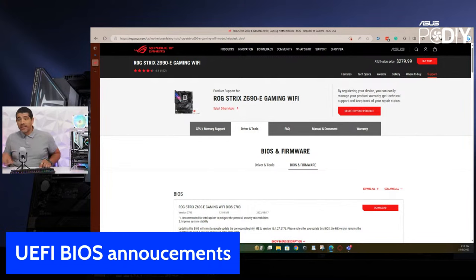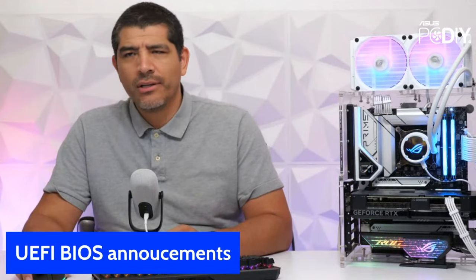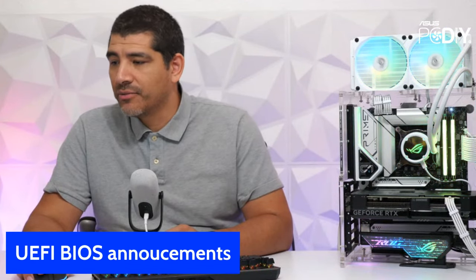If you fail to update the MEI firmware, and also potentially the MEI driver, your system can have a large amount of instability or other problems. I've actually seen people do this where they've updated the UEFI BIOS, but they have not updated the MEI firmware. So do keep in mind, if you are going to make this update, it is important to keep the updates in alignment. Update the UEFI BIOS, and also make sure you're doing that update for the MEI firmware. Okay, so that's pretty straightforward, and that pretty much covers all of the updates respective to UEFI BIOS releases.